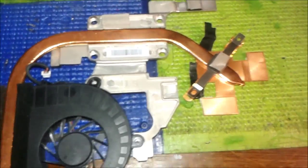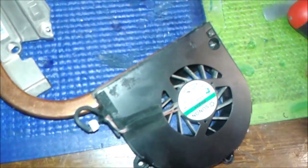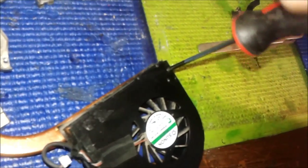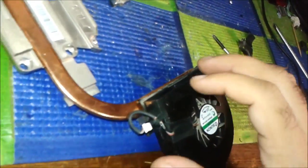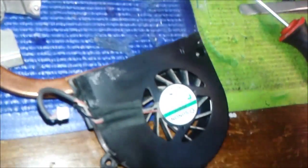This is the cooling fan. You can see the screw here I removed and the fan can open. You can see the exhaust — it's a little bit clean but we have to clean it up properly and check if the fan is working properly. I'm going to open the fan screw and check the fan. You must keep the screw in a safe place because you need to put it back — otherwise you can't close the fan cover properly. There's one clip here — just pull up and the casing goes up. There's also a small clip on this side to open.